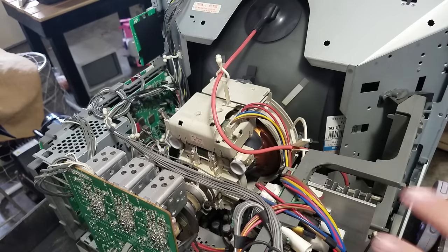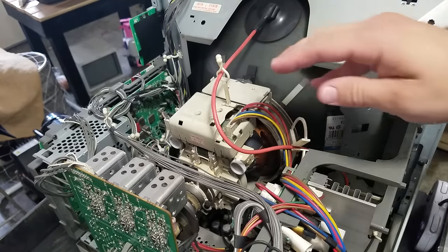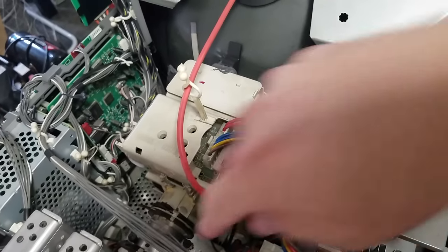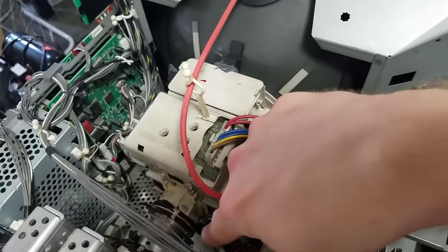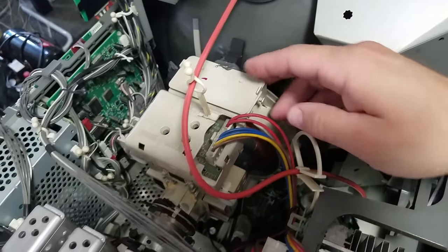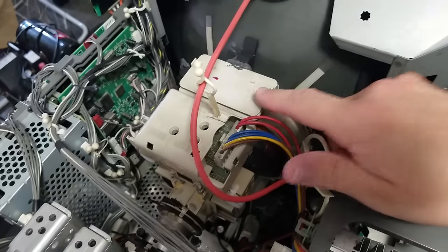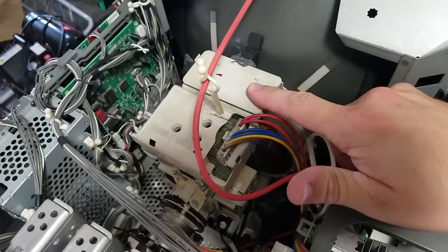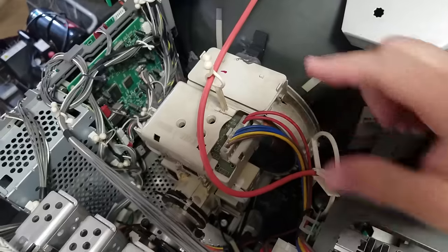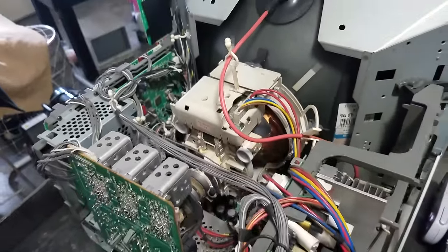Back here at the 20L5 — you can see right away how much bigger this yoke assembly is. We'll need to loosen that one screw a bit, and this one will probably need to come back a touch since I had a hard time getting it to wiggle. We'll set up our calibration screen later and move this into place, because getting the yoke set is the most important thing. Then you can make all the rest of the adjustments from the service menu.